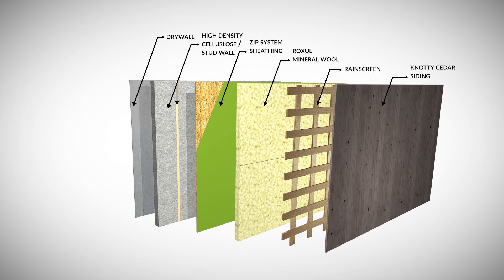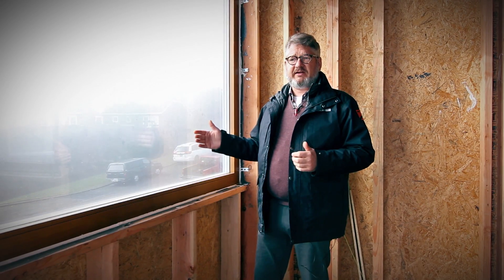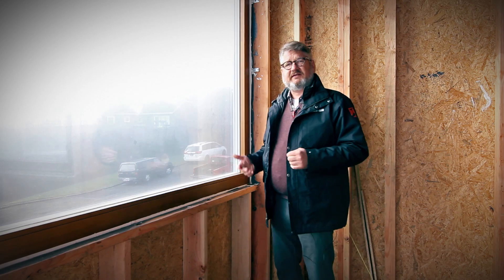And then three and a half inches of rock wool insulation to the exterior — so CI, or continuous insulation, also referred to as monolithic exterior insulation — and then a ventilated rain screen system out to the support of that.